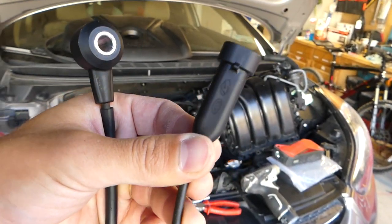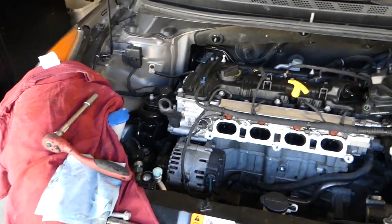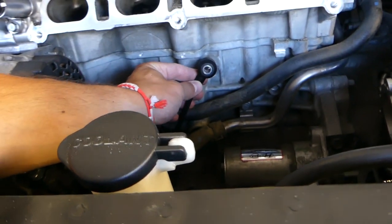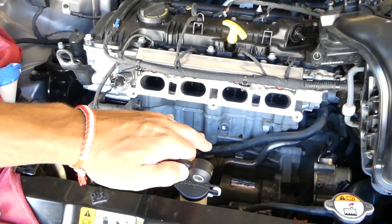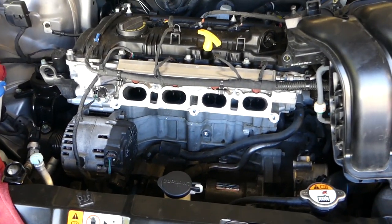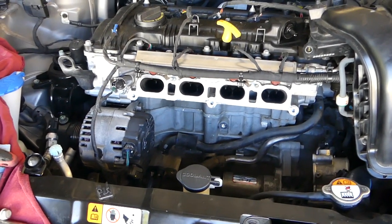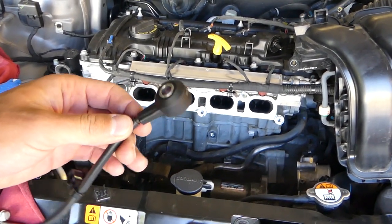You can see the Kia and Hyundai logo on it. The knock sensor is located on the engine block — right here — one bolt holds it. Usually you have to remove the intake since it's behind the intake to get to the knock sensor. We have the full video on our channel, so check it out. Not a very complicated procedure, but it will take some time.